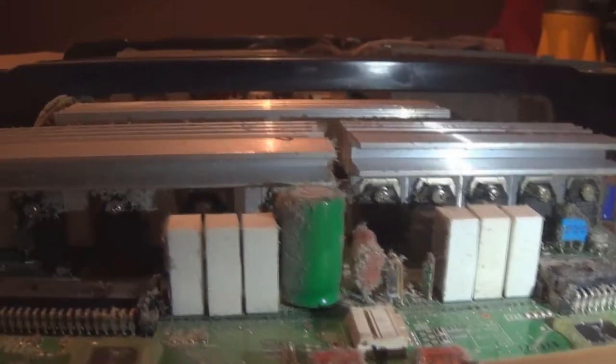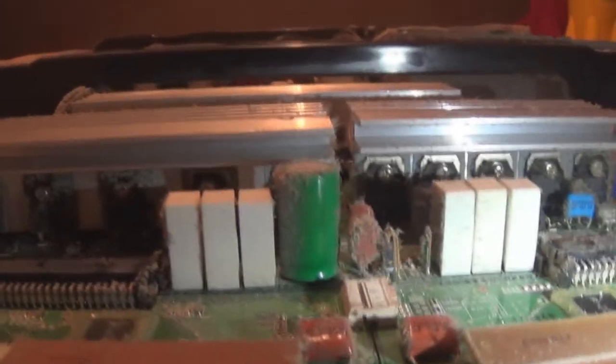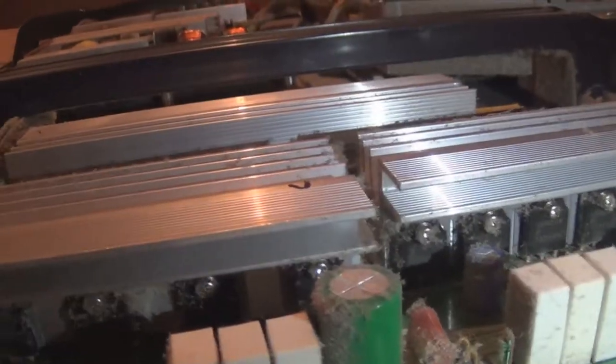Like the RJH34W - they don't blow up nearly as much. Those FETs have a habit of going short circuit. But the other TV I'm going to take its Y-main out of, which has more reliable FETs, has a fan directly over the Y-main heatsinks, so that should make it a bit more reliable.